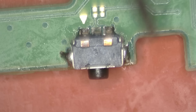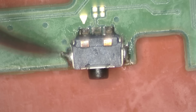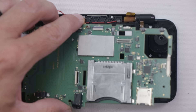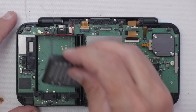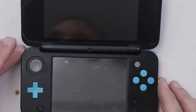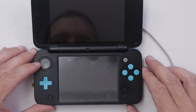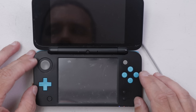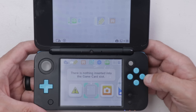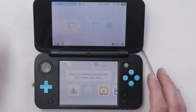And thirdly, we had to fix the button that I found in the case when I removed it. Luckily this one was a pretty easy fix — just had to mount it right here, fix this mount so it got connected to the motherboard a little bit better, and then solder all three points. This button over here is now in good shape. Now that we've got these buttons fixed, let's get it back in and see if it works. So we've got number two fixed — at least I think. It does charge still, that's good. And it does turn on. Left button works, right button works, right shoulder works, and left shoulder works. Great news. So this one is almost done — I just need to give it a good cleaning and then we'll be done with console number two.